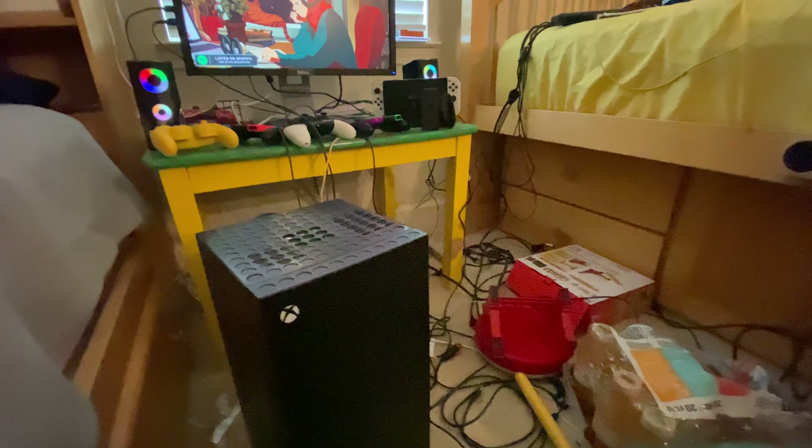Let me show you what happens when I try to plug the Xbox fridge into AC power. Nope, nothing. I already tested the 12V DC one and it works, but the AC one doesn't work. Looking at my tester it's not even turning on, and the fan isn't running at all. So the AC power supply is dead. And the cable itself is fine — I already tested it.